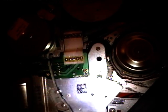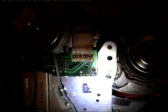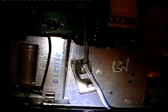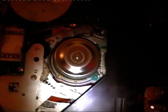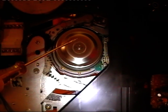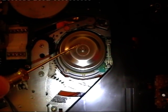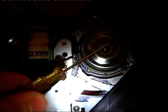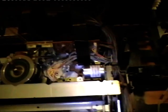The loading gears - let's stop so we can see better. There we have a large cam gear. Let's press play again - really nice. And of course the drum motor, which is on the bottom side of the mechanism. On modern VCRs the drum motor is on the upper side of the drum; here it's on the bottom side. So there we have one motor, two, three, four, and on the upper side that makes five motors total. It's really really heavy - let's put it back.